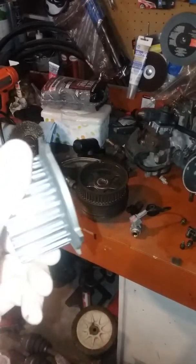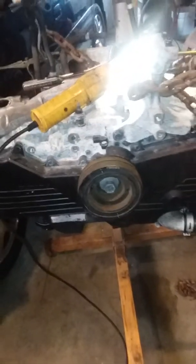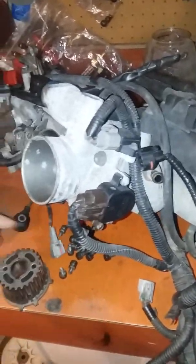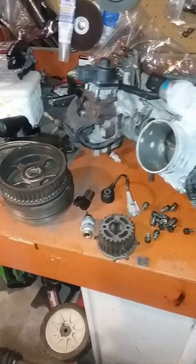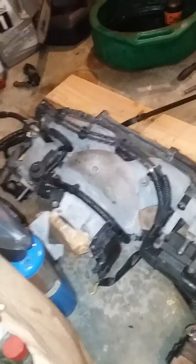The reason you swap all this over is your crank sprocket — there's a little tab on the back of it that's different than the two-liter, and so are the little notches on the back of your cam sprocket. The harmonic balancer is also different. I'm not entirely sure if you need to use the sensors off the 2.5, but I'm going to anyway. The two-liter's intake system is drive-by-wire, and there are some subtle differences between the 2.0 and 2.5, so that's certainly not going to work in this Outback — you have to swap the 2.5's intake over to make it work.